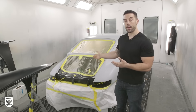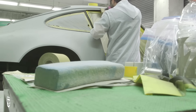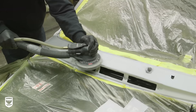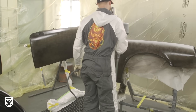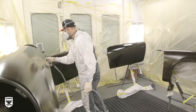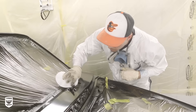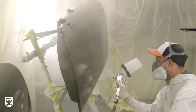The car has been completely primed and block sanded at 220 and 320 grit, then sanded down with 400, 600, and 800 grit — the perfect finish for a base coat to be applied. It's the smoothest finish, gives it enough grit, and is coarse enough for the base coat to embed into. We're applying a waterborne paint because there are fewer solvents to push through the clear coat, giving it a cleaner finish. Two coats of base will be applied, then the car inspected for imperfections — anything not right will be de-nibbed — followed by a final coat of base and two coats of clear coat.